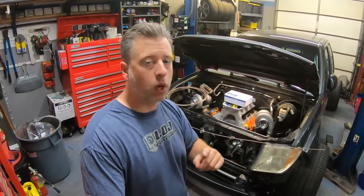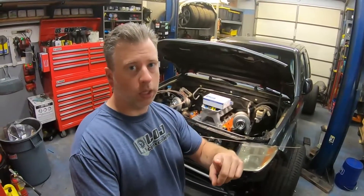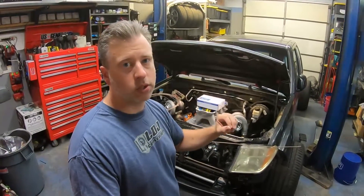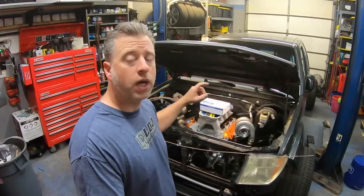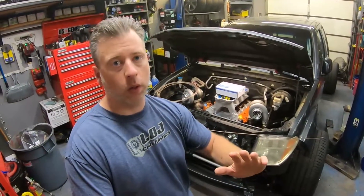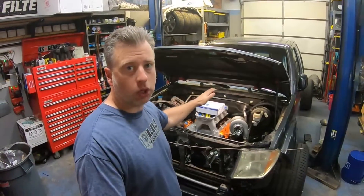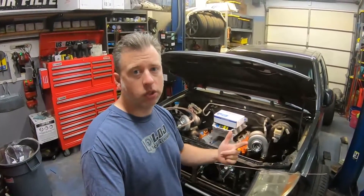If we're lucky we'll get the clutch master cylinder mounted as well. This was a factory automatic truck — we already put the clutch pedal in, but we need to put in a Tilton master cylinder because the Nissan master cylinder is too small of a diameter to flow enough fluid to move a GM slave cylinder. So we have to put an upsized master cylinder in to work with the available pedal throw to get enough fluid to that slave cylinder to actuate the clutch on this TR-6060 transmission. That's today's goal — thanks so much for tuning in and let's get to work.